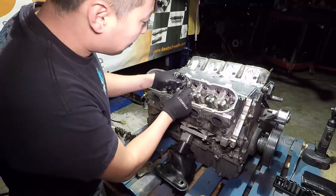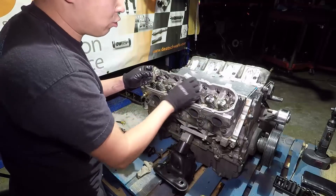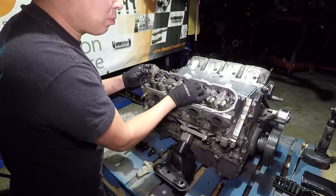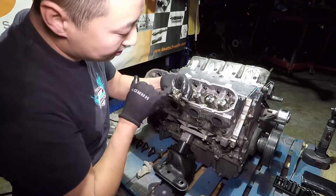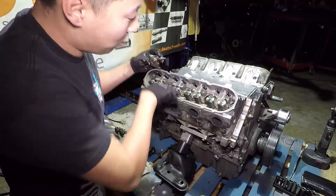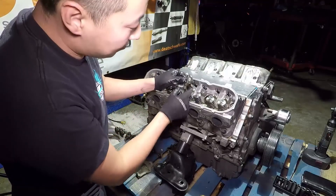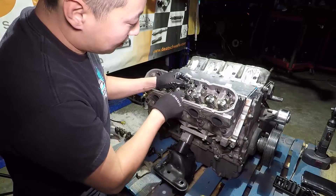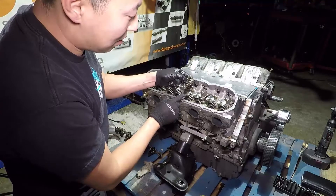So what happens is, this is the push rod. The push rod transfers the force from the cam which is in the middle of the motor spinning — the push rod is going up and down. The rocker has a divot for where the push rod sits and it's got a flat tappet where it pushes down on the valves. So every time the push rod comes up, it's going to push down the valve — that kind of motion is what actuates your valves.